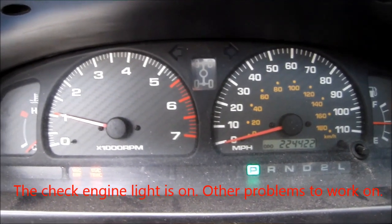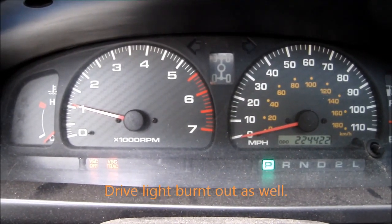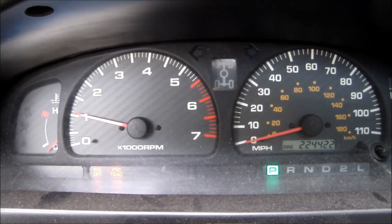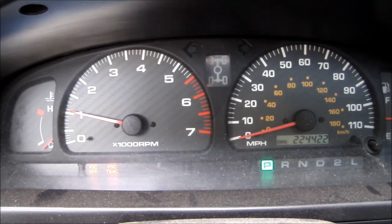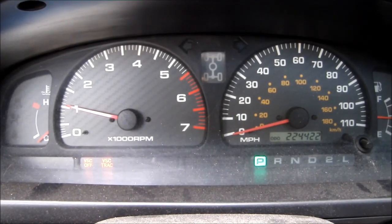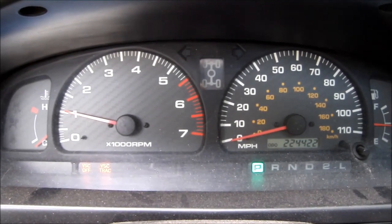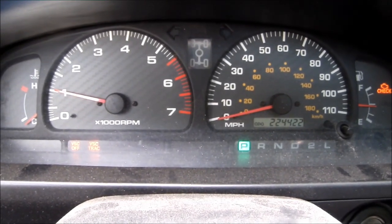It has been a few days since I went through and worked on the ADD actuator for locking the front differential and putting new oil in the front axle, as well as replacing the oil in the transfer case, which both of them weren't too bad, but they probably needed to be changed. I know I never did the front differential. I'd say that the previous owner maybe used Royal Purple because of the color of it coming out, had kind of a purplish tinge to it.